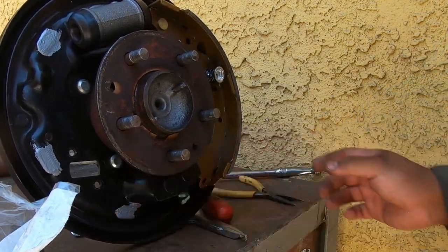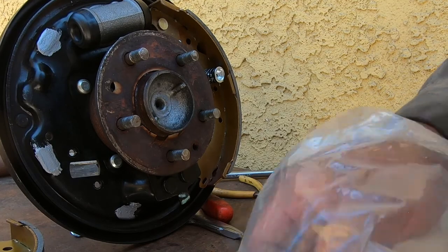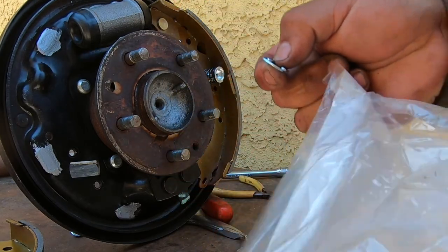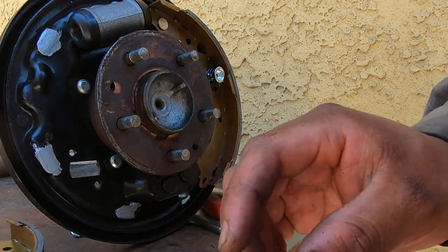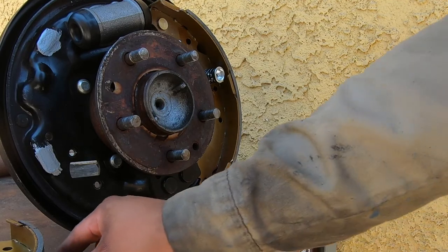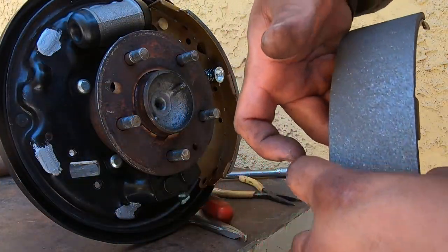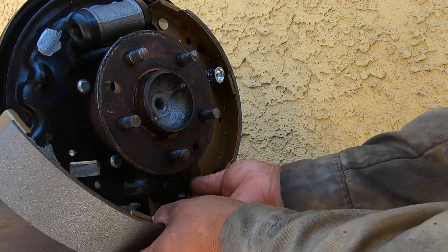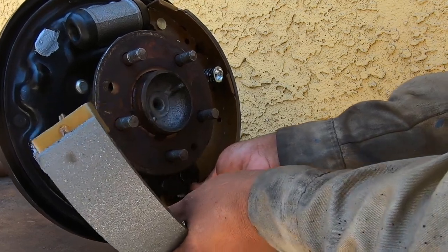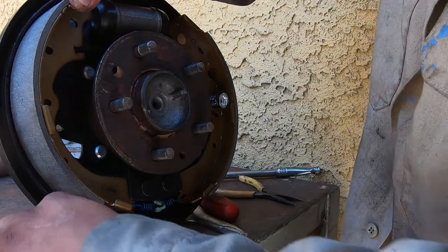Make sure that it's sitting properly. Now we're going to get the other side. You have to get the other little tab — these are the ones we're talking about; you could replace these on the shoes but we didn't. This kit comes with this little rubber piece for the back of the new one — we were missing one, but since the kit comes with it we're good. This little spring holds both of these into place and it has to go behind the little metal piece back here. Make sure you take pictures of everything before you start doing this so you can remember how it goes.